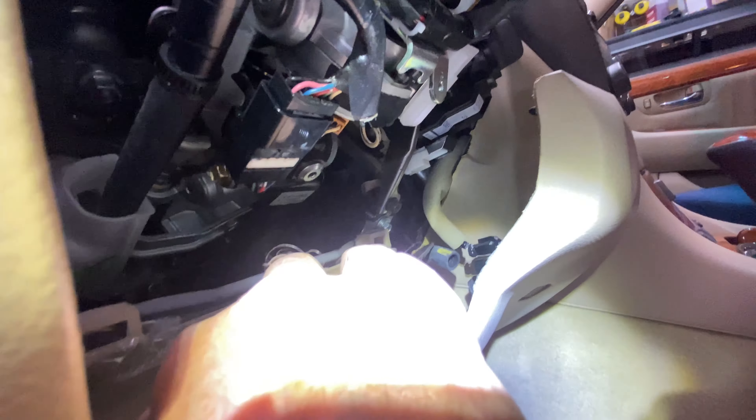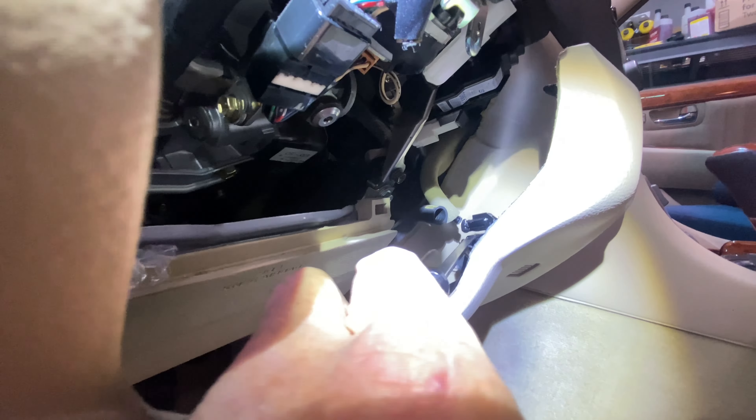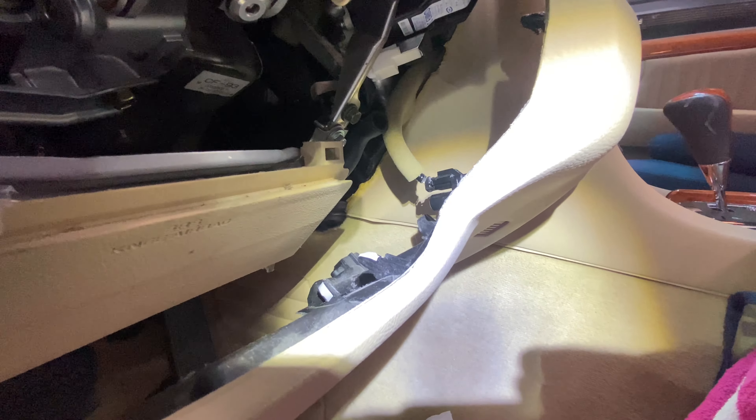Let me get some orientation. Right side, steering wheel, left-hand drive. I'm going to show you some items in here. There's this hose — see it? It goes on this plastic piece right there. Why is there a hose on this plastic piece? Because hidden behind here are some wires, and it appears to be a temperature sensor. I assume vacuum comes through this hose past the wires like a mass sensor, senses the temperature, and adjusts it automatically.